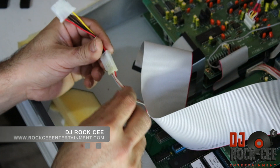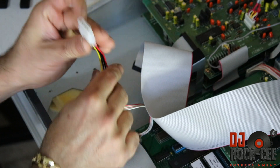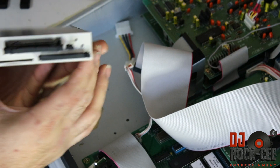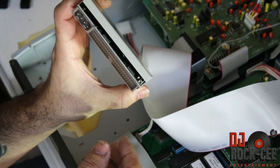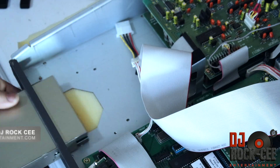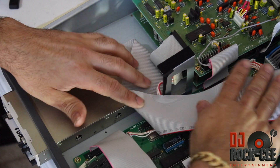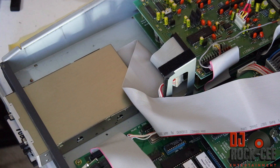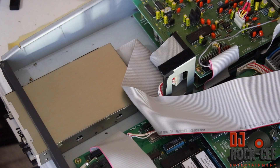Next, what you want to do is connect your SCSI adapter into your SCSI motherboard. Our next step is to connect this floppy connector and convert it into your SCSI power connector. This is our drive right here — it's a 50-pin. Next, get all your ribbon cable out of the way, and you can flip the unit and put your screws back into your new compact flash drive.